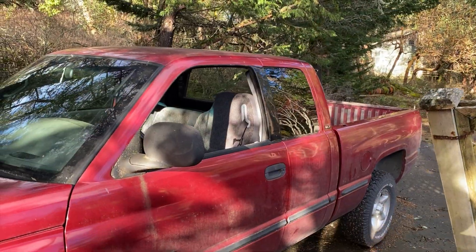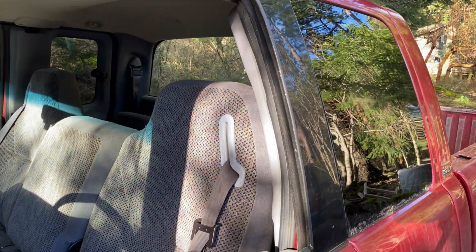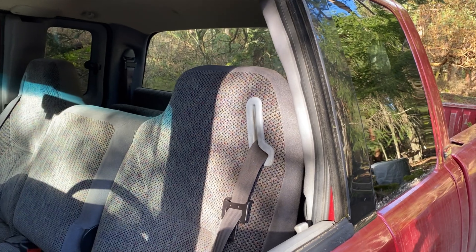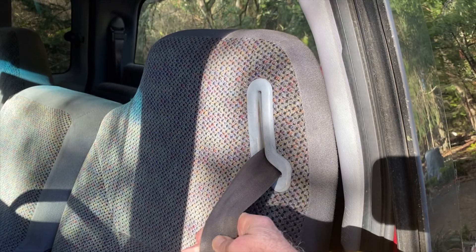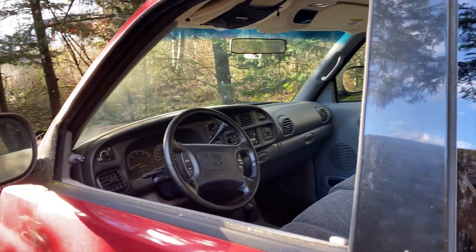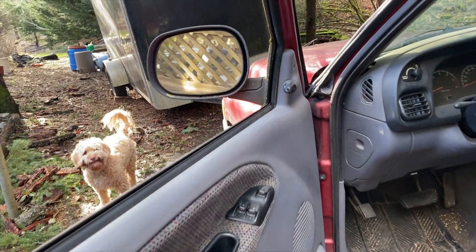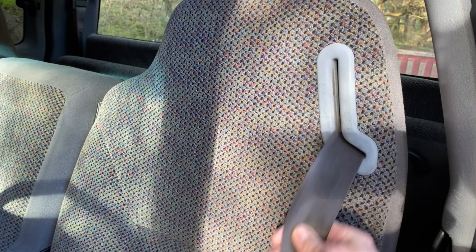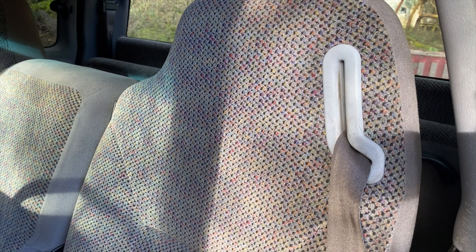How does the normal module deal with that? After you turn the key off and close both doors, within about 30 minutes a normal seat belt timer module turns itself off. I've left this vehicle alone for about an hour with the window open — you can see that seat belt is locked. The seat belt timer module gets input from the door jambs, so let's see what happens when I open the door. With the door open, even with the key off, the seat belt is released — the module wakes itself up as soon as either door jamb is opened.